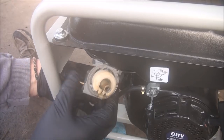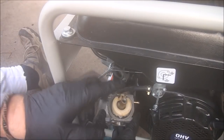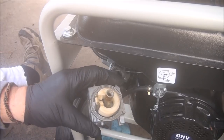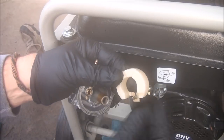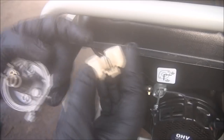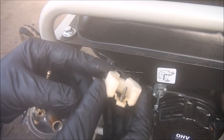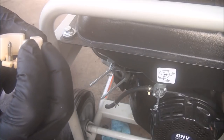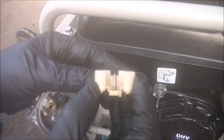You can see we have quite a bit of corrosion on the inside as well, so we need to make sure to clean this off. We're going to go ahead and take the float off — don't lose anything. If you lift the float off like this, the float needle will stay in place. There's a little spring that holds it in place — I'm just going to leave it on there. That's one of the most important parts inside your carburetor. That little valve does wear out after time — it's always a good idea to replace it, but I'm going to reuse this one for now.